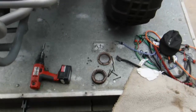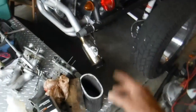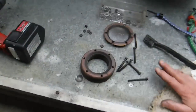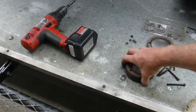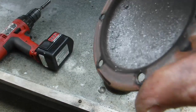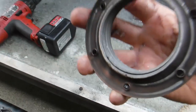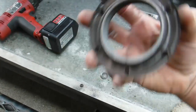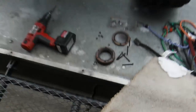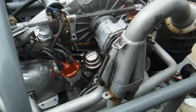I went to their website because I have another car running a SuperTrapp on my 2110. I added little washers between the discs, which is probably not a good idea. The whole disc pack was on backwards, and you can see in the end piece all the junk inside there. As you start looking through the disc packs you can see a buildup of crud in there. That's one of the reasons why I wasn't tuning well — it wasn't set up right, and he had retarded the timing back to 10 degrees.